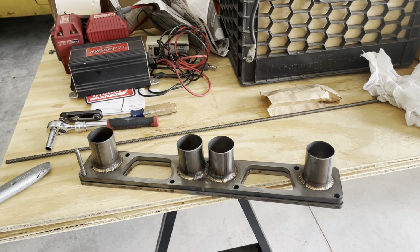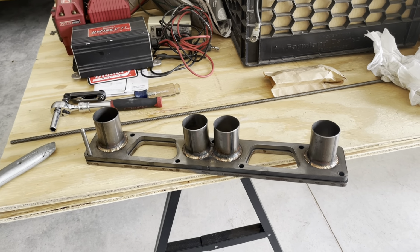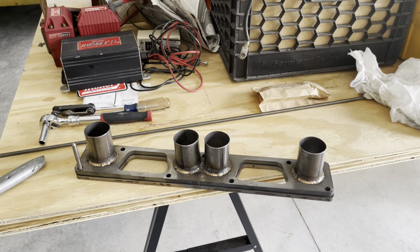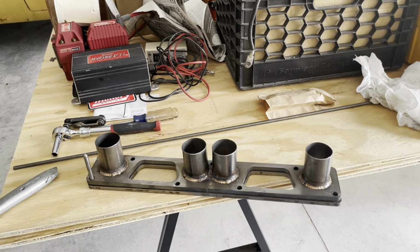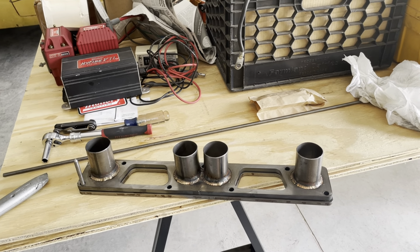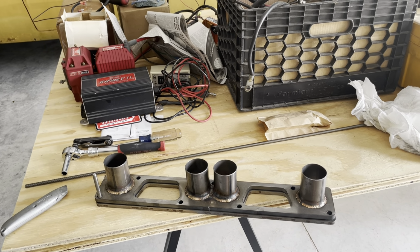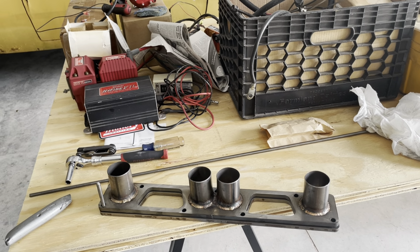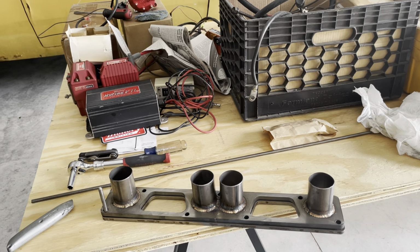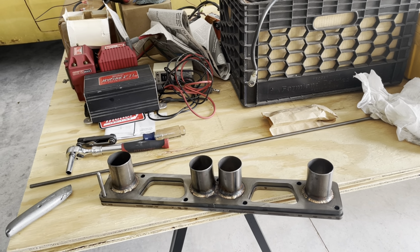Maybe, if I'm lucky, I'll get my skills brushed up and start making custom headers. Not too crazy about what's on the market. They're all wrong, and there's no good solution. You can break out your slide rulers and abacuses and theoretics and formulas. No such thing as a perfect header. Just make what works. I think I could do better than some of the offerings. Specifically thinking of the firing order. 8 and 4 are too close together. 5 and 7 are too close together. It's a lot of exhaust going down the tubes. Think about it. Until next time.